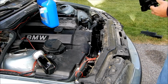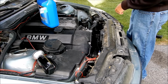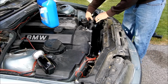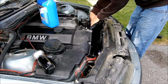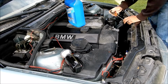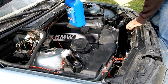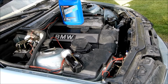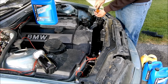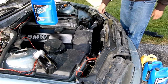So I'm gonna put this one in. We'll fill it up, try to bleed it, and hopefully we have a winner. I've never had good luck with these sealings, so hopefully this will actually work. Maybe that's it. Go get some coolant. It's from the video I saw. Take this out and then fill this up and let the air bleed out of here.